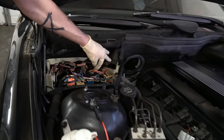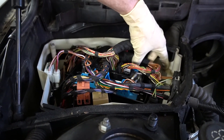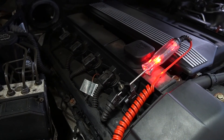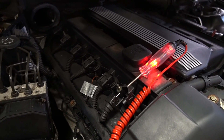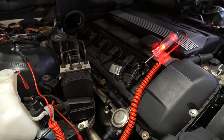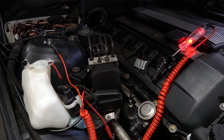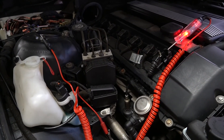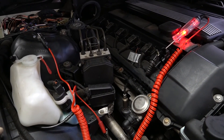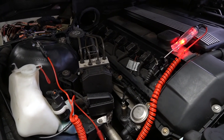Basically what's happening is nothing is getting enough constant power to actually do anything. The motor can be cranking, but if there's no spark or no signal to the fuel pump to send more fuel, the car's not going to start. I swap tested the main relay for the DME and it did the same thing. But I can screw with the main relay, just push on it to get a different connection, and now it has power again and the car will start. So our approach is to remove the DME and check for signs of damage — mostly corrosion from water. If that's the case, we're going to purchase a new DME, get it sent out and programmed to the EWS for this vehicle. There is a chance that there are other spots corroded within the whole box, but we're going to start at the most important part first.